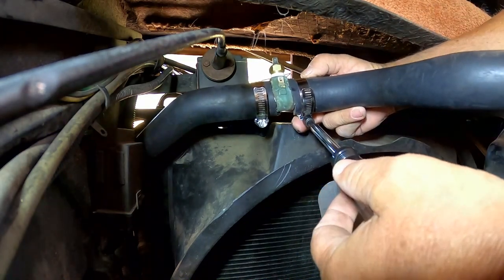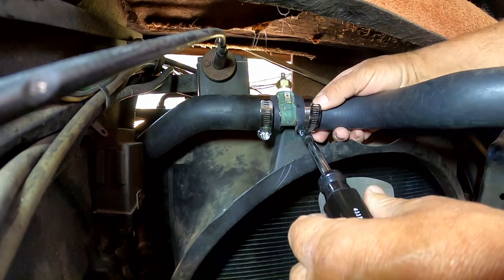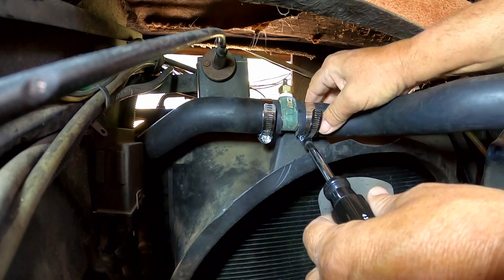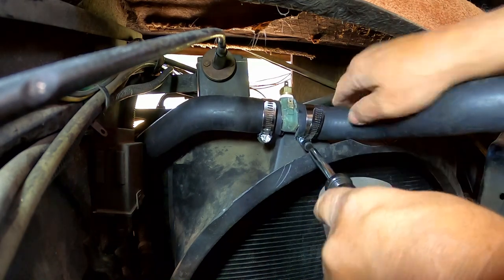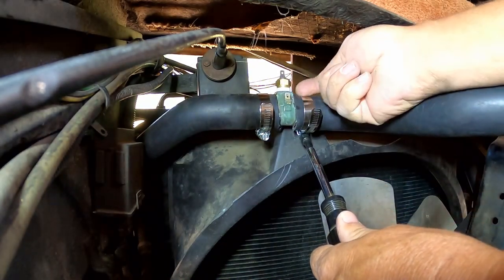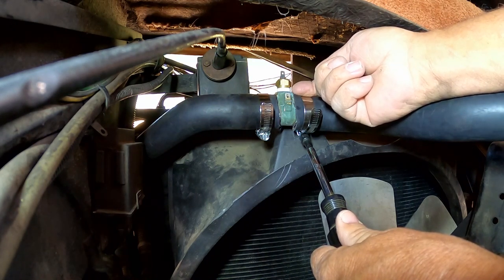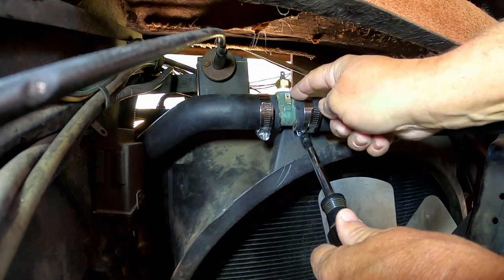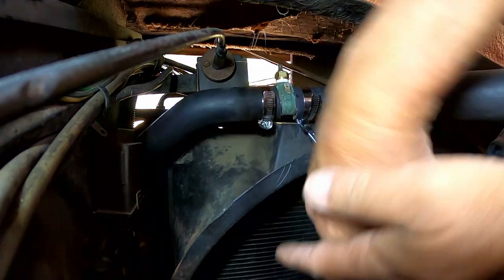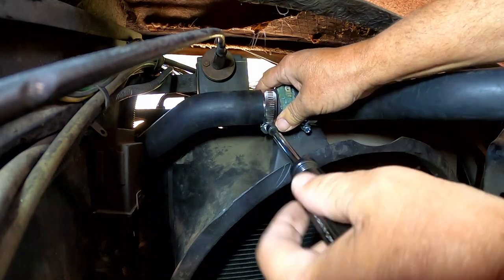let's see here. Let's get it just right. It's more important that that clamp is properly placed in relation to that swollen area, that barb, than it is the cut. And the hose is pressed up. It goes all the way up to this part of this housing, which is square here, where actually it's a hex to put a wrench on, on the body of this, and then that hex. So it's all the way up against it. Yeah. All right. This one here, it's looking pretty good.